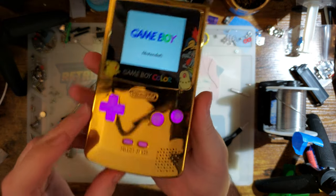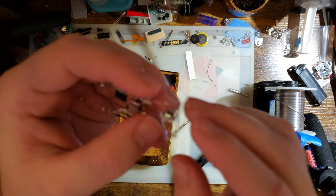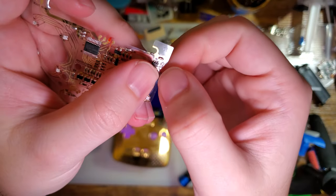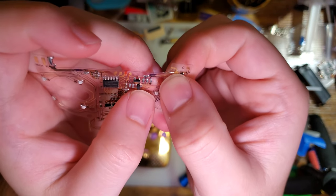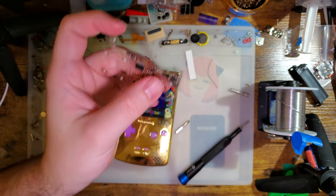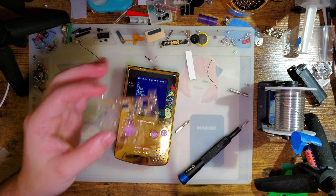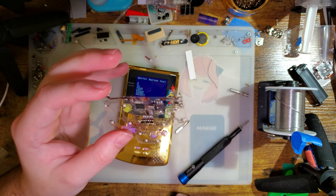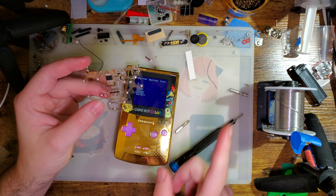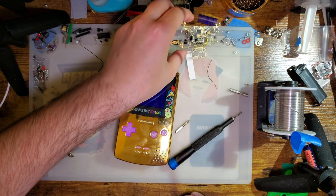And then I suppose let's go ahead and go over the backlight modes. Something that I neglected to cover last few times, but there is one extra solder pad up here, right near one of the cart headers that you're supposed to solder to for power. This C pad here, if you have that wired up properly, you have it wired up to your power switch so that this thing can detect the battery voltage that your Game Boy is using. That results in a low power warning where the lights will blink, but that only works if you have an internal lithium ion mod, like, for example, FunnyPlaying's rechargeable battery kit.